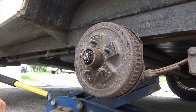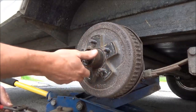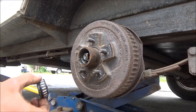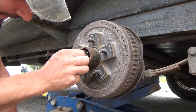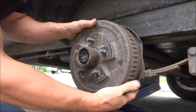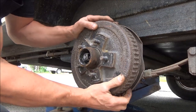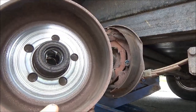Starting to feel sprinkles, so we've got to work fast. Get that out, take this nut off — usually these aren't much more than finger tight, so you usually don't need the appropriate size socket. The brakes aren't adjusted up real tight, so this will slide off. A lot of times you can put that nut back on, and that will aid in taking the inner bearing and seal out — you pull it out about halfway, let it drop down, and just bang it out. It'll actually hit that seal and bearing right out. Didn't work on this one though.